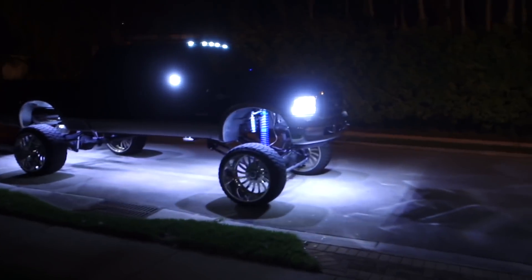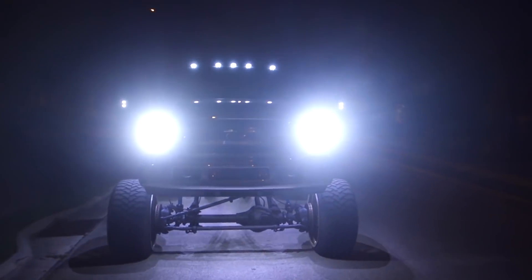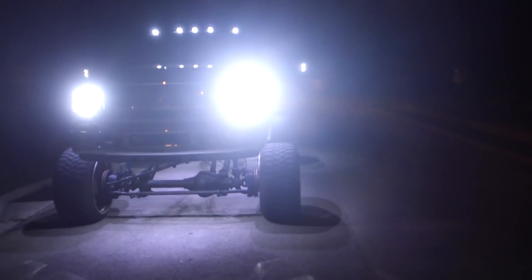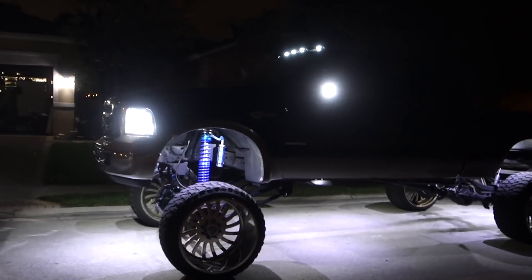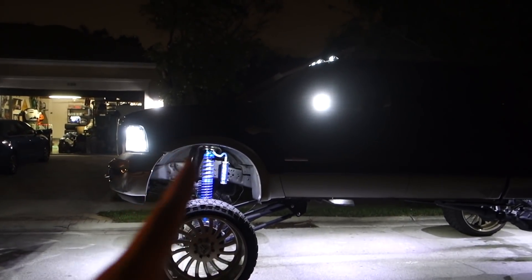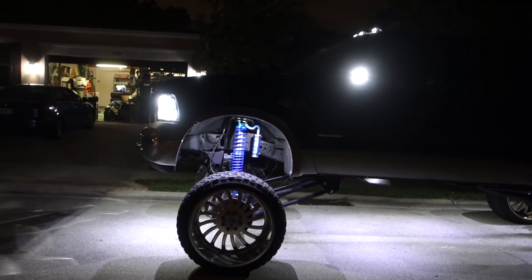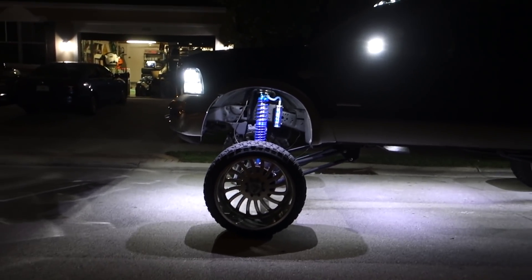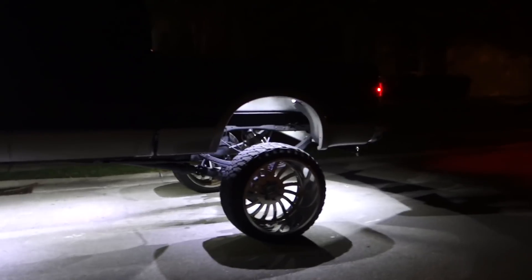It handles a lot better, no bump steer. Overall it's really solid, and it looks a lot better with the front wheels pushed back out. It looks like a spaceship. I fixed the steering — the steering wheel's straight now. Track bar is aligning the front. The lights are blinding. It's looking super good. You can see that the coilovers are slightly tilted forward, which is really good — it means it has some positive caster, which is ideal. That's exactly what you want. The four-link bars are dropped down a little more. It looks really good. Fixed the geometry.